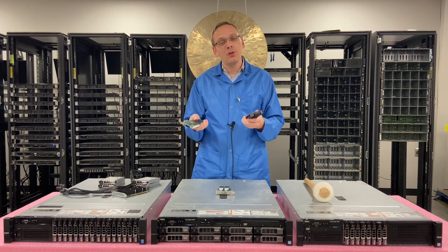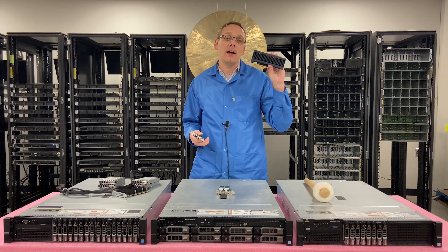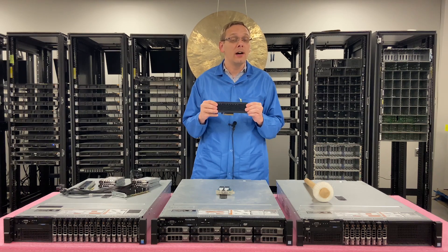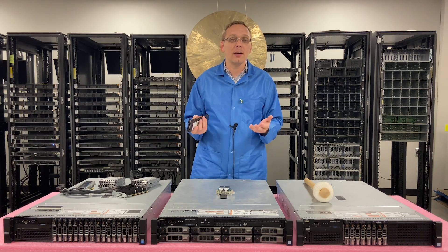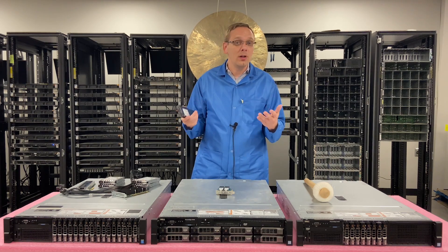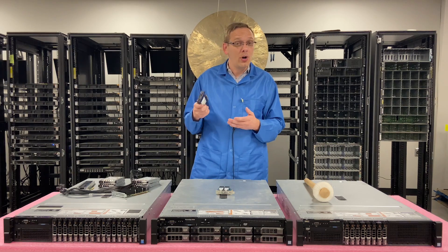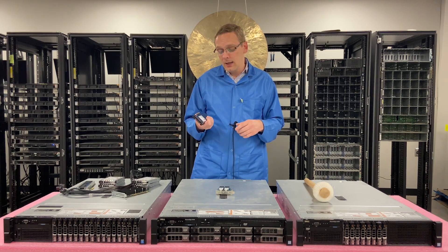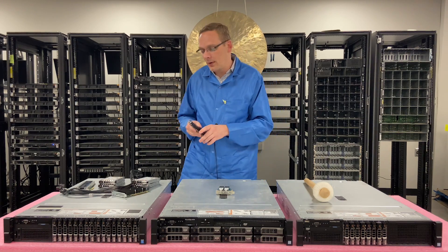Next option: PCIe. Same situation — if you install just a regular Intel or Samsung, it will not work. You need a Dell NVMe PCIe. The Intels and Samsungs without Dell firmware won't be recognized at all. The ones that do have Dell firmware will actually work, but it's super limited. If you try to go into the iDRAC setting, it will show up but not as a physical disk, so you can't install an OS onto it or use it in a RAID configuration. If you install VMware and try to put an OS on it, same thing — won't work. Really all you can do is use it as extra storage via the BIOS device configurator. So to me, the PCIe version is kind of out.